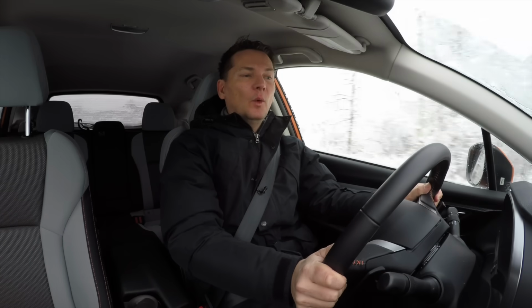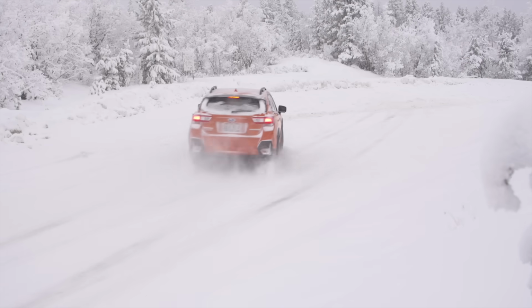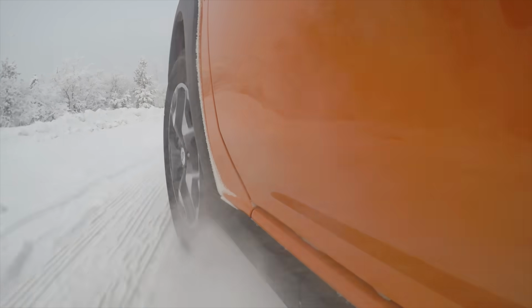Now we're in the car with the winter tires. So we're at our mark, and we turn and brake. And you can hear the ABS working, and it has more available grip from the softer compound tires to actually grip and stop us in a more controlled fashion. So the next car with the all seasons, I think we're going to find out, but I think it's going to be a marked difference.